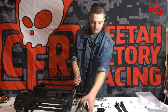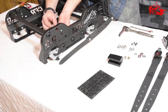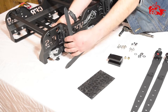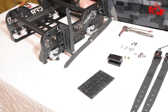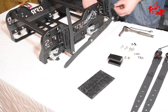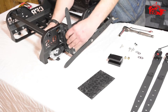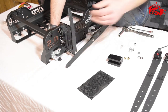Now for the front one, there are three holes up here but we recommend for general setups you want to start with that top hole. If you find you need a little more adjustment once you have it on your sled you can always change it after — this is the general setup that works for most people. Got that set screw in. Now we want our carriage bolts — these little guys are going to go right into that slot back there. Into their new home on the bracket. Get these black cap nuts on just loosely, get them in the front too. Can't put the nut on if the bolt's not in there — that's life advice for you.